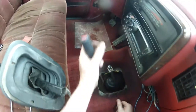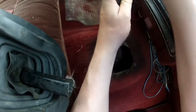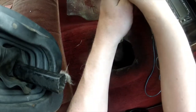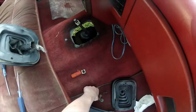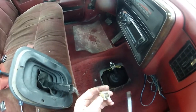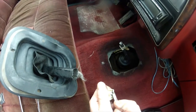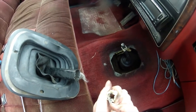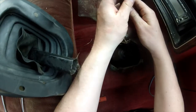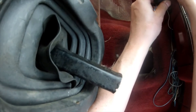I've been working on this with a flat blade screwdriver, tapping down on both sides and working it down. It will get stuck on these notches. One thing I did before starting: on these back parts, take the screwdriver and chamfer that edge on both sides — not super hard, just lightly. That helps it slide past these notches.